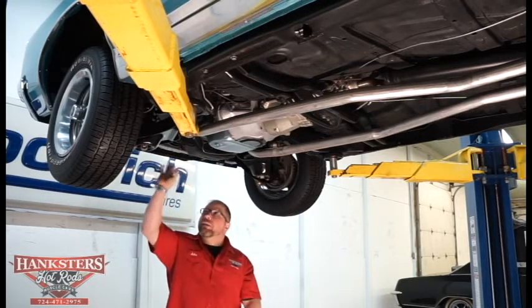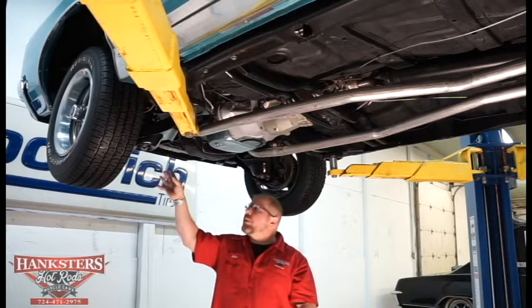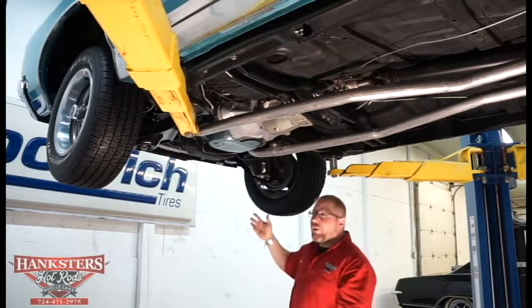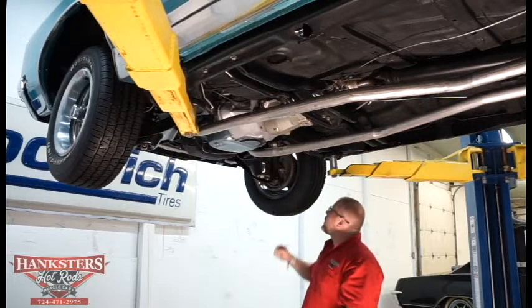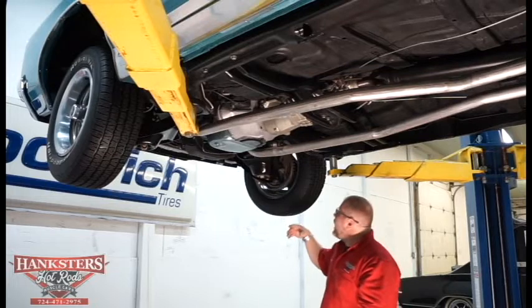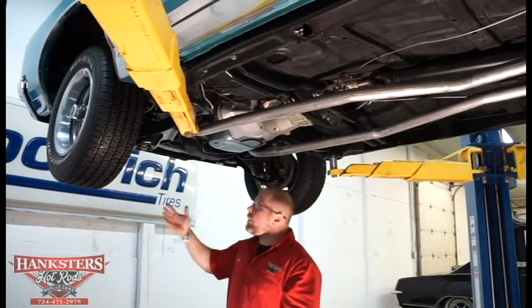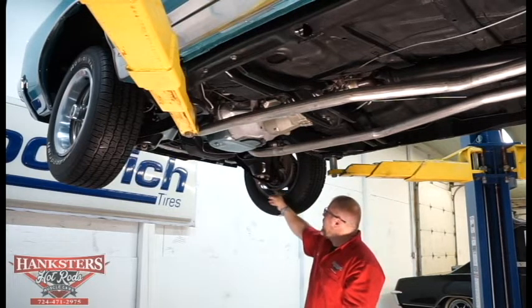As far as the suspension arms up front, now these are just going to be your stock stamped steel components. So your lower control arms and your upper A arms, all of which look to be, they're probably powder coated from the factory, I would assume. But again, those all look to be in great shape. Shocks look like they've been swapped out on this car sometime fairly soon, not long ago, because again, all of your bushings and the mounting hardware on all of it is in great condition. Ball joints, all of that stuff looks to have been replaced fairly recently too. Those are in great shape.